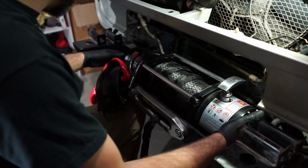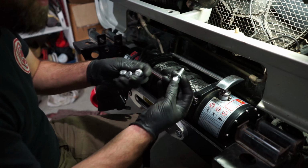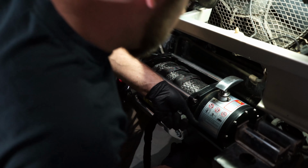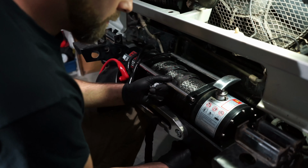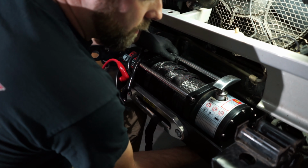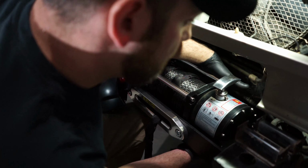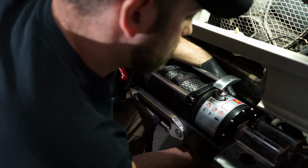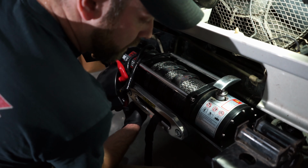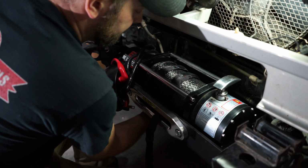Just place her in there like that. Much easier. I was trying to do it with the cooler in place, and you just can't do it. There's no room. Now take your bolts. They have lock washers and washers on them, and sneak them around. Fish them, fishy, fishy. There we go. Just obviously want to get it close enough to where you can get them in, and then just go finger tight for now while you're getting them all in there. There we go. Sometimes they move a little bit, so just make sure they didn't move out. And then once they are all in, zap them down, tighten them down real good. If you want a torque spec, I will put that up now.